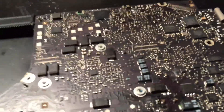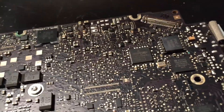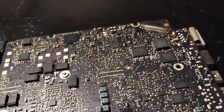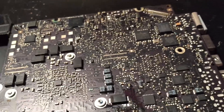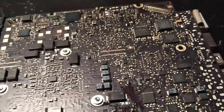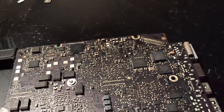Alright, after looking around in the schematic and doing testing for quite a bit, I could not find anything obviously wrong. So what I'm going to do now is take this chip off — this is actually a different board, a donor board with a probably good chip on it. That board is bad, so I'm not taking a chip off a good machine. Based on the schematic, I realized that this Broadcom Ethernet controller is also the controller for the SD card reader. That would make sense: if this chip was bad, neither of those two devices would work — and indeed, the system does not detect either the Ethernet controller or the SD card controller. So more than likely this chip is bad, and I'm going to replace it on the 2011 board.